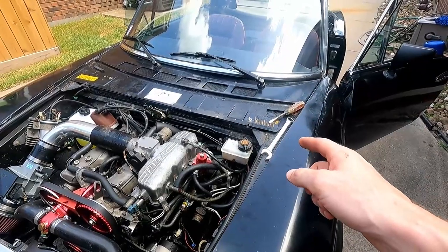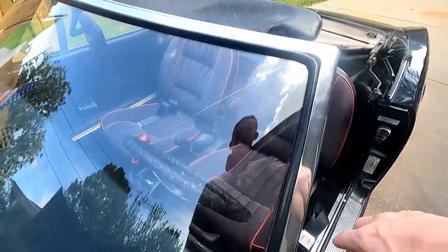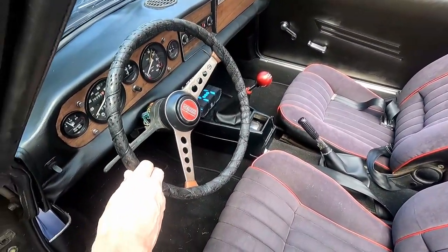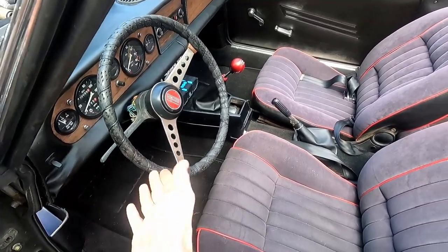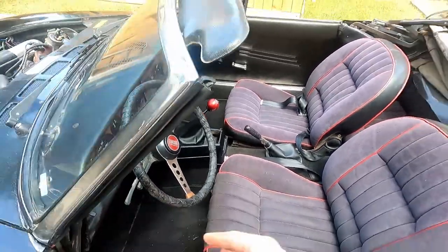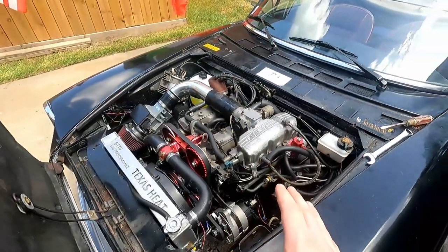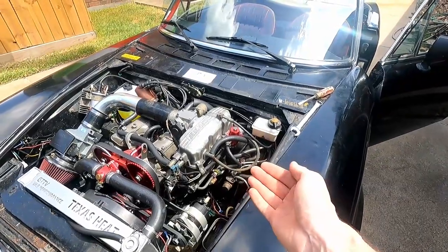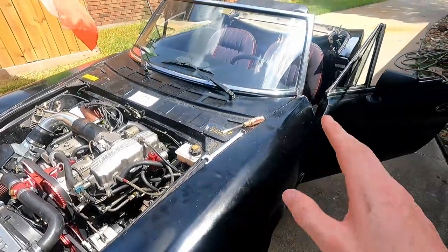Make sure that screw on the outside is still loose, but once you get it nice and tight — you'll see here on the steering wheel — it's much tighter, much much tighter. A little bit of give is just the car itself. I could go a little tighter but I'm going to test drive it first to make sure it's accurate. So we tighten down that lock nut on top to make sure it doesn't adjust itself out and loosen up again.